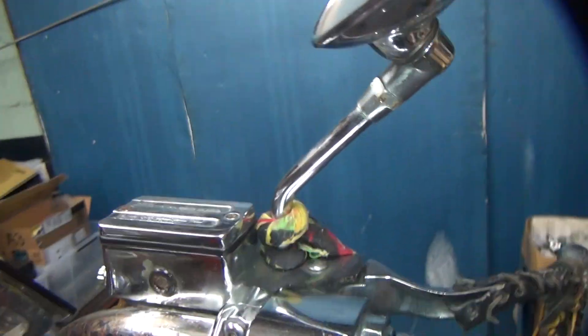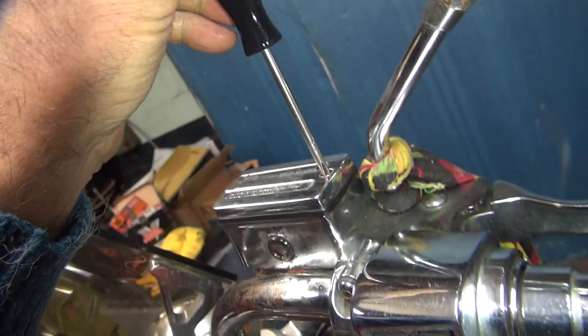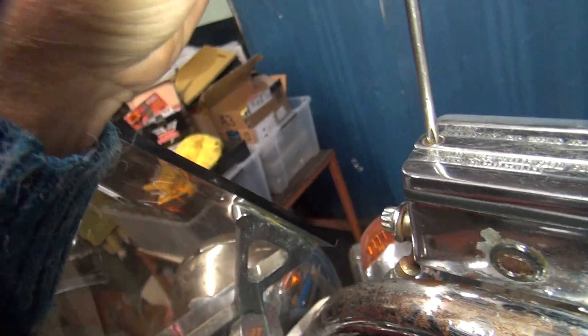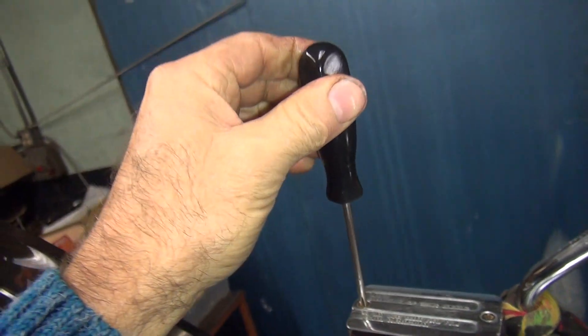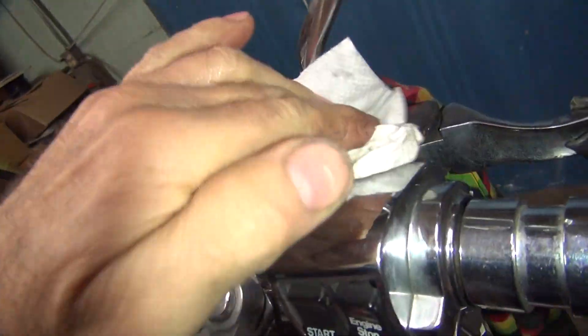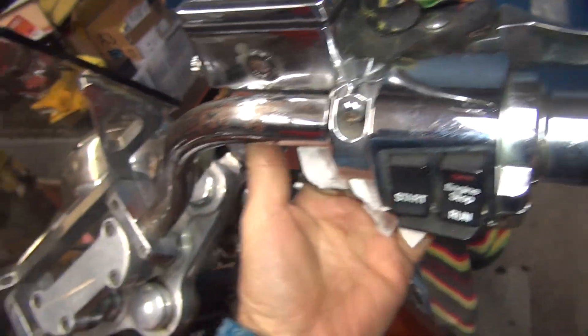As you turn it, you'll see the rubber come out slightly - it doesn't take much pressure. Going to wipe it down anyway since some fluid spilled out the bottom. Wipe off anything you might see down there - wipe it off just to make sure there's no fluid left on the brake components.